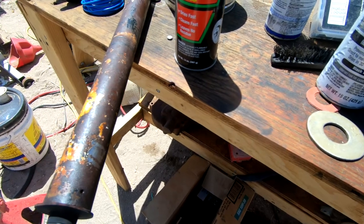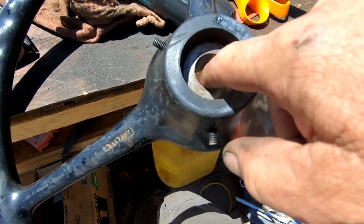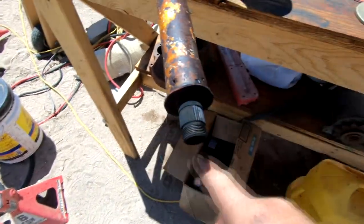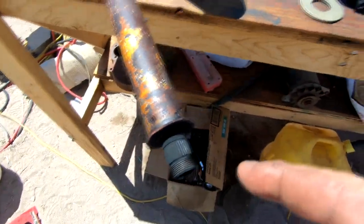I'm going to attempt a way to make it work and it involves JB Weld. I want the JB Weld to adhere to the inside of this hub, and as it cures I want it to mold itself to this spline, so I will have effectively created an inserted spline or a sleeved spline in this hub. The JB Weld is strong enough to handle this as long as we got good clean surfaces and we get good adhesion.